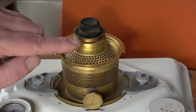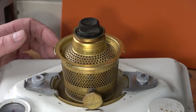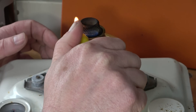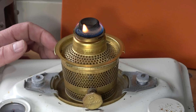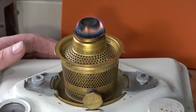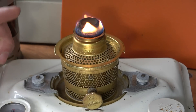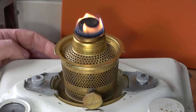Make sure the wick is at the right level - you can adjust it with this knob here. Any old lighter will do and you just light it. That's going to go around full circle. If you have that wick too high it's all going to be yellow flame - you're ideally looking at a blue flame. Once this is settled down that will just burn blue. Right now it's just burning off excess because this hasn't been lit for a long time.